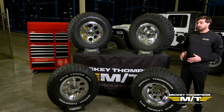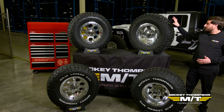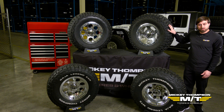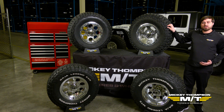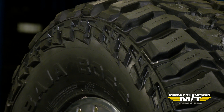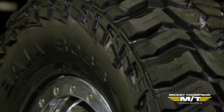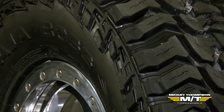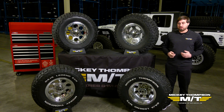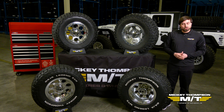The difference between Power Ply XD and standard Power Ply comes down to a few things. The Power Ply XD features a 50% heavier denier third ply — a denser third ply — which increases sidewall durability, especially puncture resistance. It also increases stability on the road for a nicer driving experience, and provides an even quicker reaction to steering input, making it a tire you can rely on in emergency situations like a sudden lane change or quick turn.